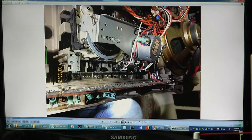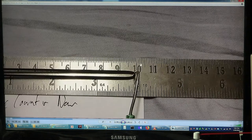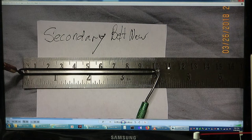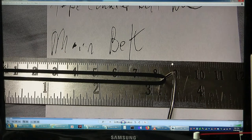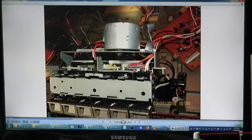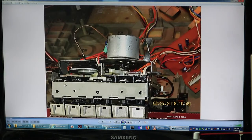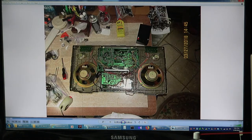It's a really fun thing to take apart. This was all full of black stuff. Here - under flywheel, that's the belt under the flywheel. I don't know what that belt does, it does something. And here's the tape counter belt new - it's about that big. And then here's the secondary belt new, which is about four inches. And then another picture - this one here needs to be three inches or less, like 2.9 or 3 inches, which is not three and a quarter. That's the main belt. And here's where the belts go - one goes on, the motor drives the top one, and the secondary is underneath which drives that. And then there's a third belt up under here which drives something else. And here's the fourth belt right there - that drives the tape counter, which turns the little light things and all that.